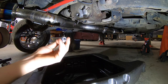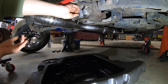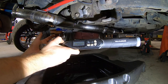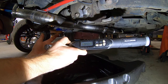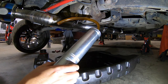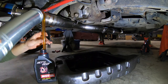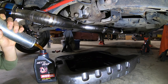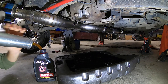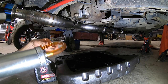Now that the fluid is completely drained out and your magnetic drain plug is clean, pop a new drain plug gasket on there and thread her all the way in by hand. I went and got my 3/8 torque wrench so I'm going to torque these ones to the exact number — the drain plug gets torqued to 44.3 foot pounds. Now we got to fill it with fluid. To fill this I'm going to be using the suction pump because there's no way I'm fitting the bottle in there. I'll shove the suction pump into the gear oil and suck a whole bunch up.